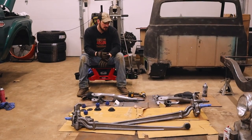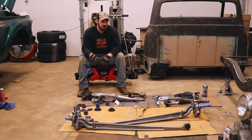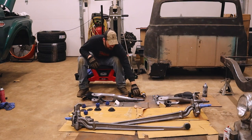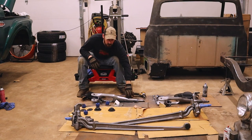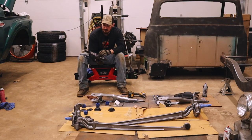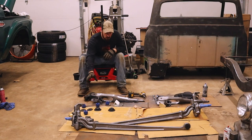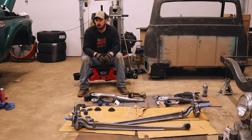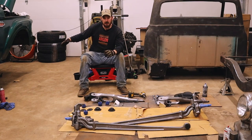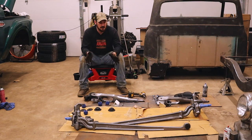I've spent all week wire wheeling, sanding, and cleaning all these parts. I hit all the parts with some rust converter — it takes any leftover surface rust on the metal and turns it black — then sanded everything down with scotch-brite and 220 grit. I painted everything using wheel paint from Duplicolor for the radius arms and I-beams, and flat black paint on everything else for protection.